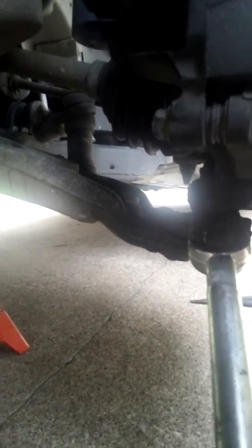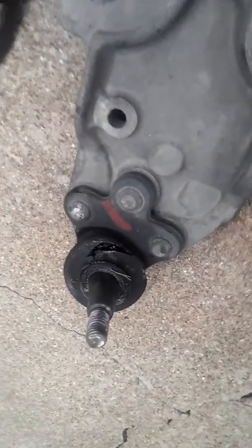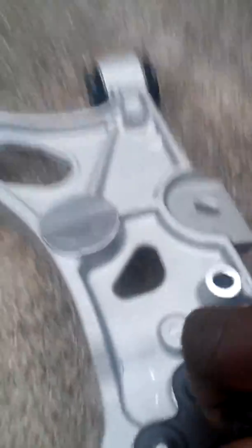I'm about to take this knuckle steering point loose here — the joint loose. I'm going to use a pickle fork and a ball peen hammer. I'll take it up in here and hit the hammer a couple times to knock it loose. It's going to ruin the rubber gasket on it, but I'm putting a whole new thing on there. This one has the Zerk fitting to go on the other side — it's the rubber gasket to hold it.